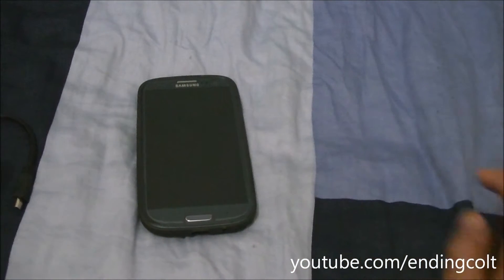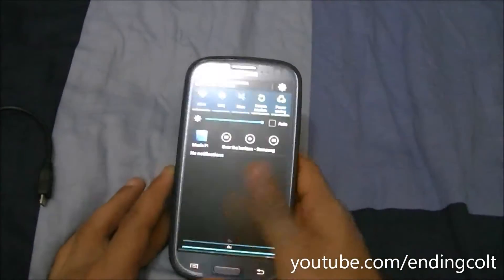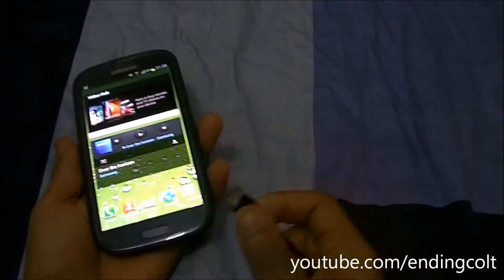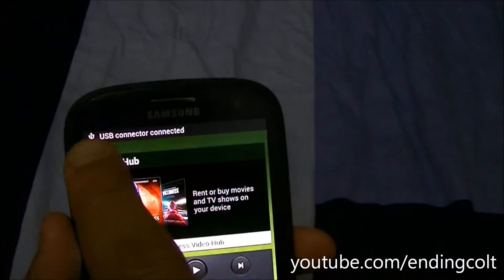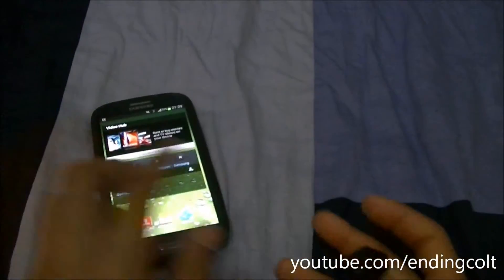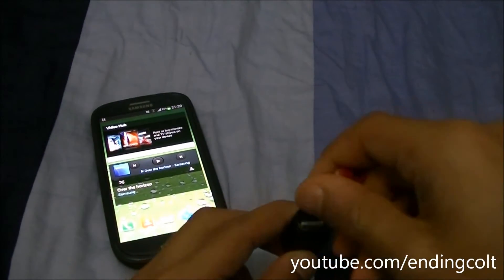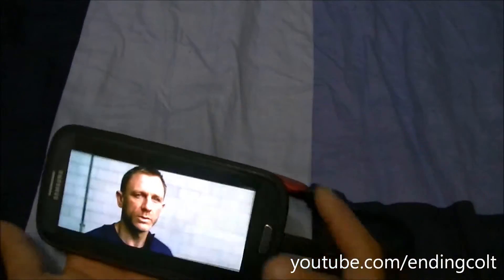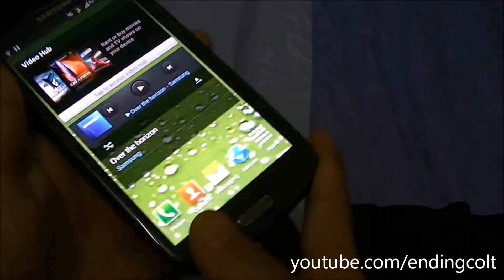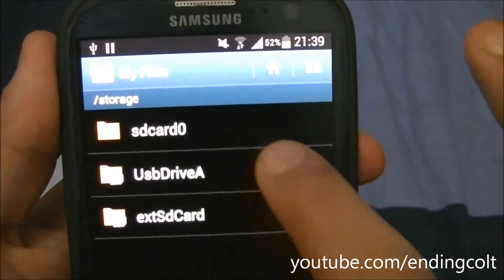Those are the two items I'll be testing via the USB OTG cable. The Galaxy S3 here is running pretty much stock. Let's go ahead and plug in our USB OTG cable — it plugs right in. Once plugged in, it should show 'USB connected.' Now we'll plug in our 8GB SanDisk pen drive, and it should show 'USB mass storage device connected.' You can find the pen drive in My Files, navigating to the USB drive.